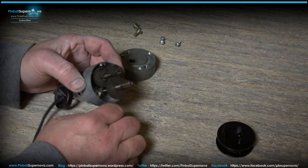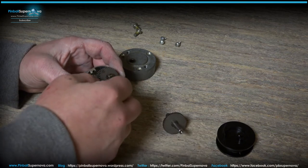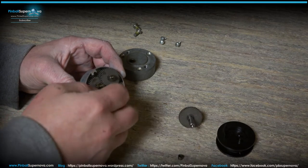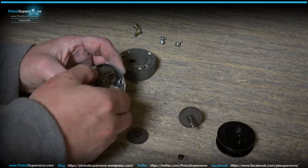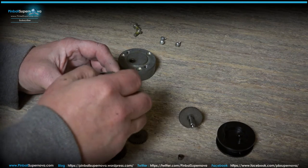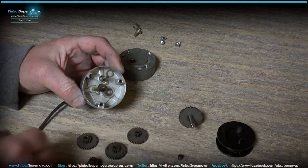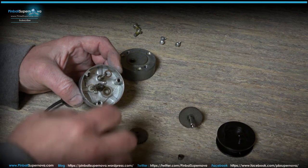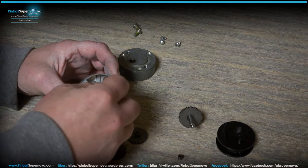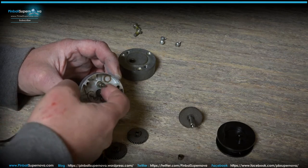So basically how you take this thing apart is that these gears just come out, and on this one there's a spacer on the top of that side, which I just took off. The gears just come off. Again, I cleaned everything underneath in the gearing assembly, and this one comes out too. Basically, for the order the gears go back in, there's two spacers on this side. There's two shafts, and one has two spacers on it.